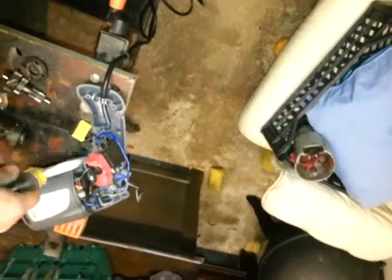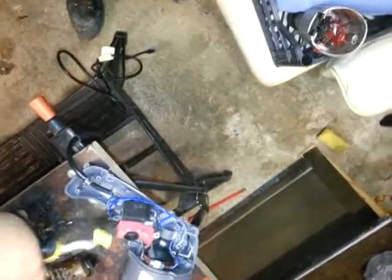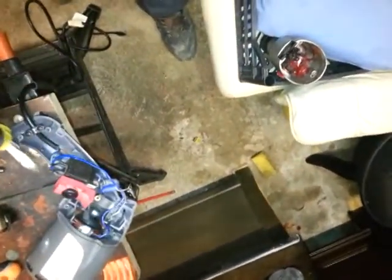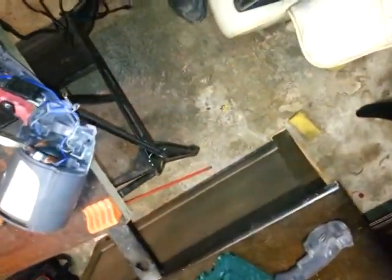I'll show you a quick trick when cutting capacitor wires. Don't cut both at the same time. You create a little explosion if you do. Best thing is not to touch them, because you've got, see, 275 volts. If those two touch, you'll see it and hear it. So, yeah. Cut the wires to the field windings, and that's about it really.